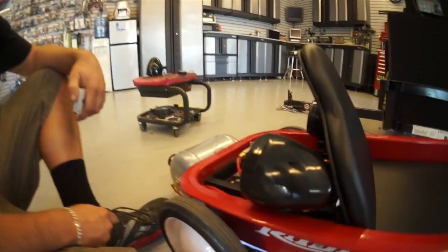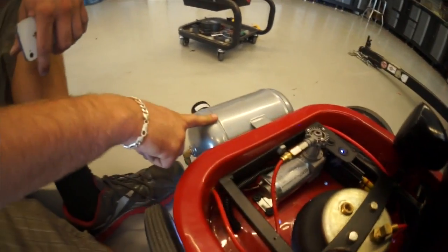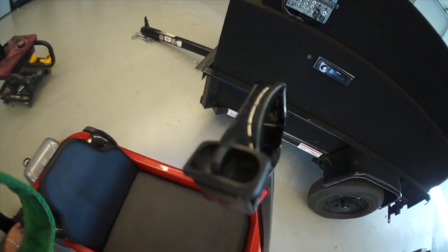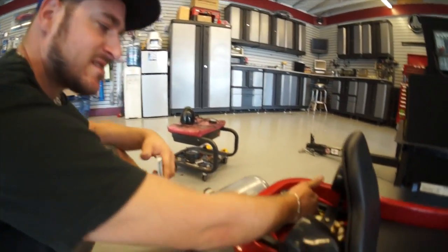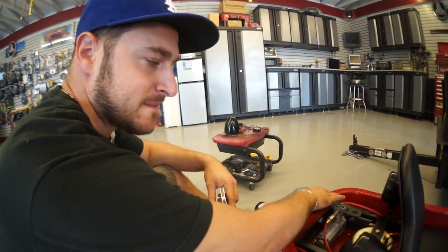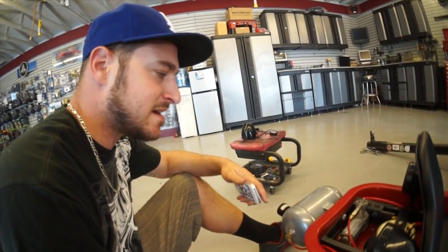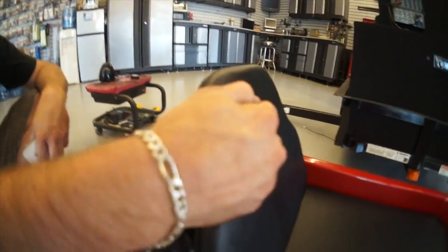On this bad boy, I started with the bag setup. Built a top mount for the bag, got my two length, widened the axle two and a half inches, and I got this little V-air compressor that fills up a one gallon tank. I got my pressure gauge and a paddle switch up on the handle so I can control it. I added three switches — one controls the LEDs underneath, LED strips; one for the compressor at 100 psi with a check valve; and one controls my stereo, turns on my Bluetooth. I got a Bluetooth module into this little Renegade amp that powers two speakers. Then I got an NVX battery underneath, a seat, and straps so my kid doesn't fall out.